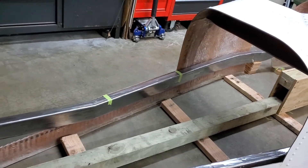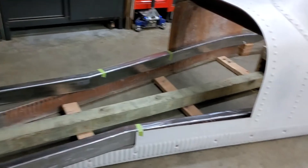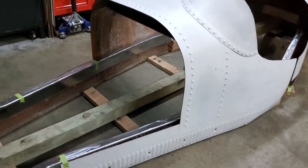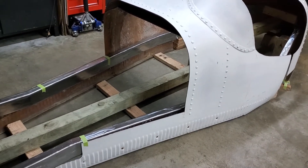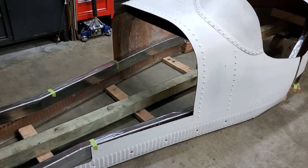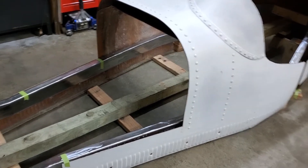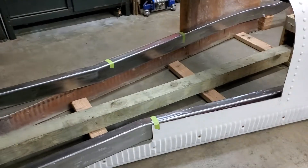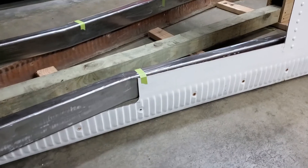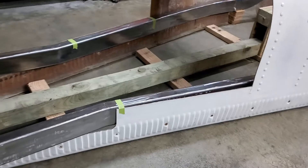Back to the car though, and more specifically the driver's hood section, which was removed from the body with a four and a half inch cutoff wheel after the scuttle and rockers were marked off. Once the hood was separated, the rocker area of the body was trimmed to allow the front frame rails to pass through them. There's a radius where the cut line turns from vertical to horizontal as the rocker continues forward and in towards the engine compartment.